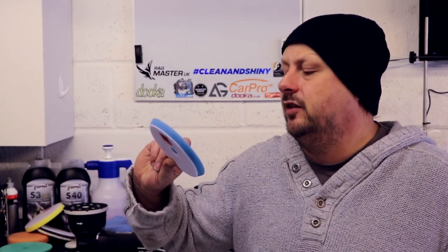Another good thing is that when you buy the tool in kit form, you are ready to go — you haven't got to buy any other accessories in terms of plates, pads, or bolt-on things. You can pick your pad choices and abrasive choices, and you're ready to go. In terms of trusting Rupes, because they're selling you the kit, they really want you to use their flat pads and abrasives. I'd be interested to see what their Mille abrasive is like — I'm guessing it needs heavy lubrication to reduce the cutting pad from sticking to the panel. When you sign up and buy the kit, you only get one of each pad, so it's really more like a taster. I would probably be exploring thicker pad options, which is down to personal choice and isn't really a deficiency of the tool.